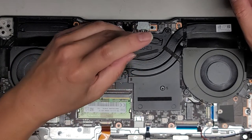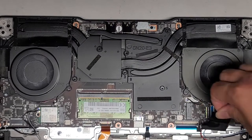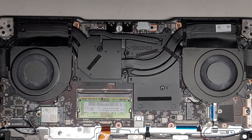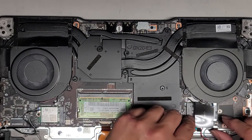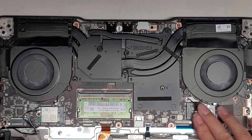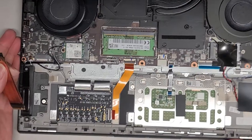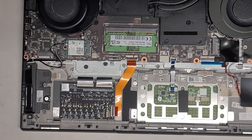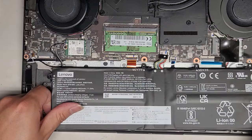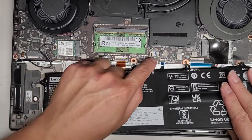I'm pretty sure this plastic piece was somewhere here. I don't know exactly where from the marks, but I'm pretty sure it was like this — it's to cover these cables, so when you put an SSD there it covers them. Now we're going to put back the SSD down here, but actually we have to put the battery first. So let's get the battery. I'm going to plug in the battery before I put the SSD because there's not enough cable slack.